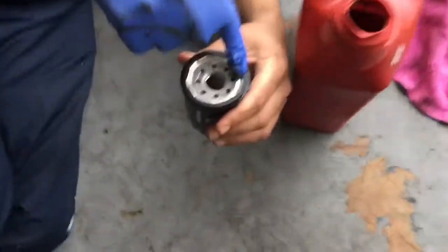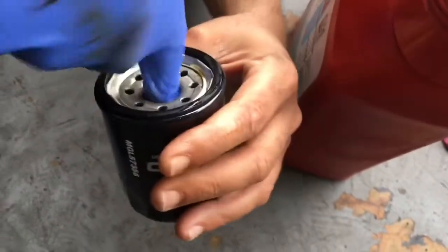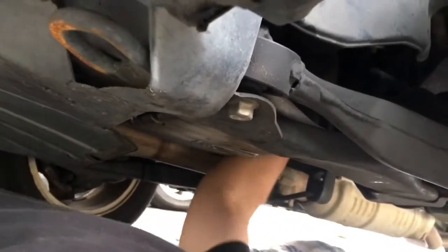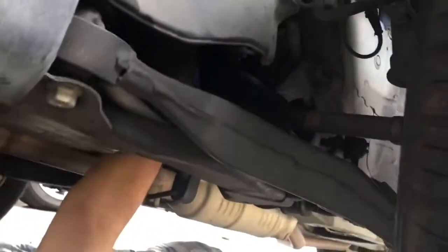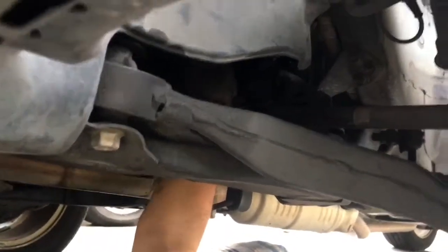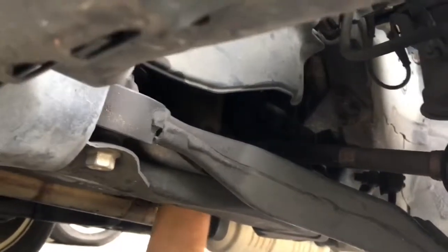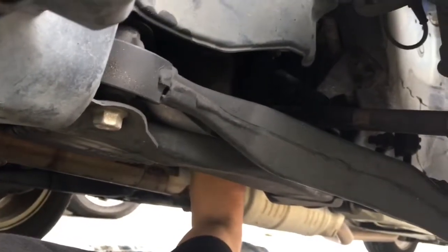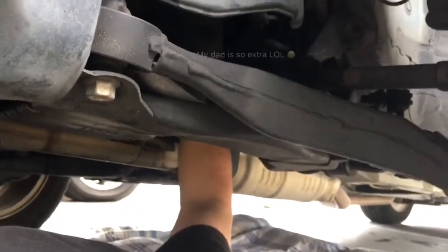This is a new oil filter. You want to lubricate the top of the ring with the new oil — stick your finger in there like so. Just put the new oil filter on. Easy peasy. The first time we changed that other Honda Accord you had, that was tough, but after that first one it was easy on the second one. Yeah, after we broke it, we had to hammer that thing. So you don't want to over-tighten it neither for the next man — as soon as it stopped, let it go.